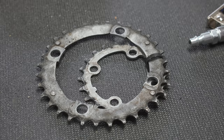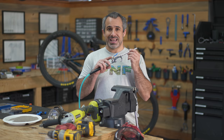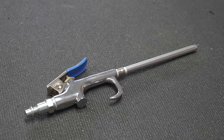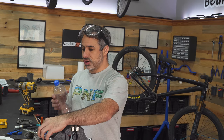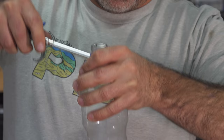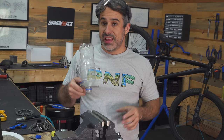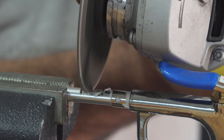If you've seen our flip bike series, we fix up a lot of bikes and restore individual bike parts, which sometimes involves cleaning them so we can paint them. I want to show you how to make a sandblaster out of an air compressor and one of these little compressed air attachments. To do this you're going to need your air sprayer, a water bottle, and of course some sand. You'll also need some tools to modify your air sprayer. First, drill a hole in the base of the bottle so that it makes an airtight seal. Next, modify the tip of the sprayer — open a little channel in it using an angle grinder.